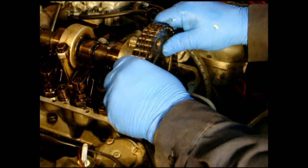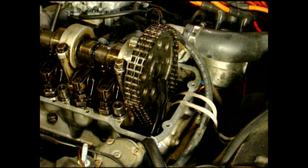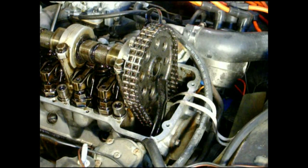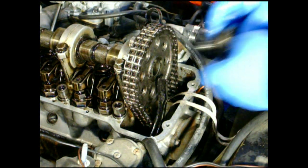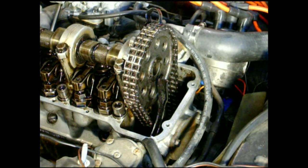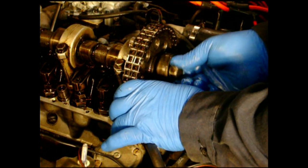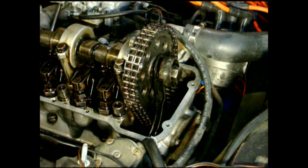It's fighting me a little bit. Oh, there we go — I don't think I had it lined up vertically well enough to get it to start. Once I gave it a little twist it went in. Okay, so we are now four degrees advanced. Those positions are in there more for accounting for stretched timing chains — that's their primary purpose, not so much for tuning valve timing. It's to compensate for retarded valve timing when your chain stretches.